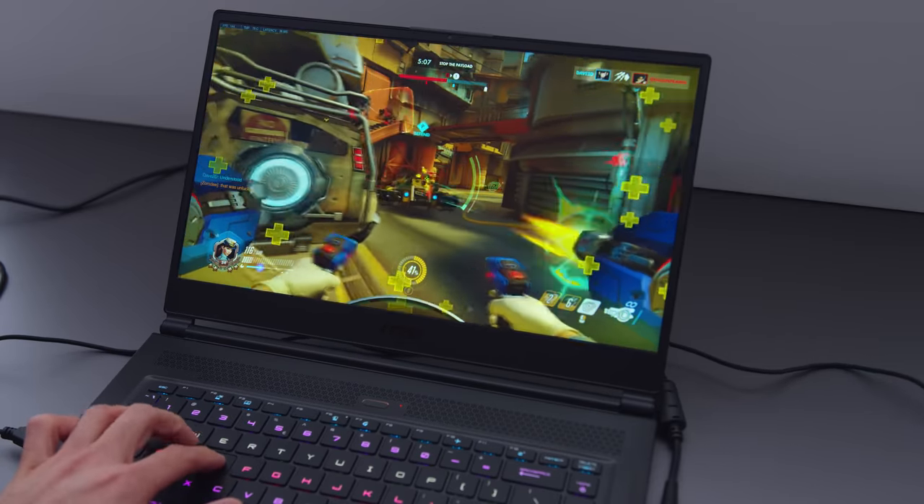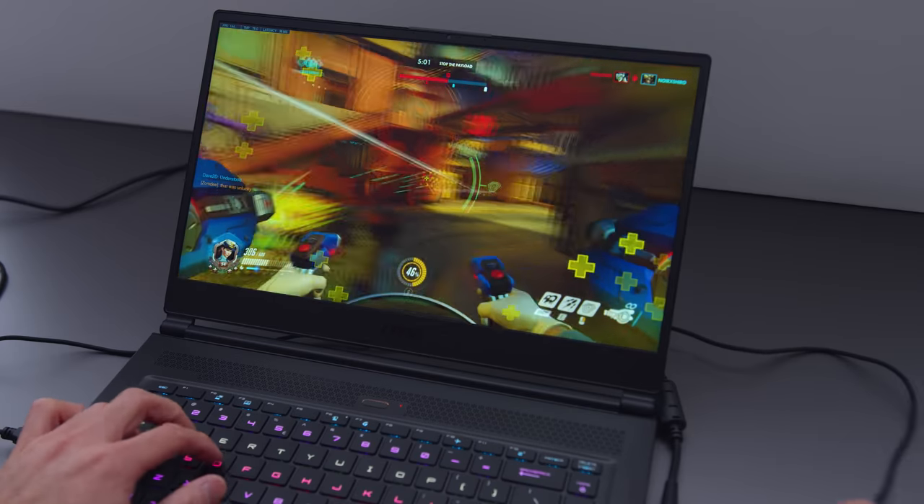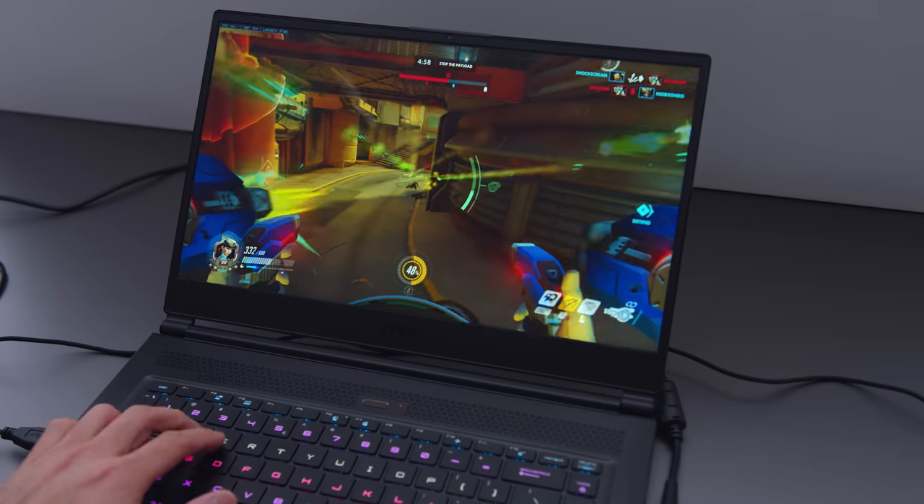One thing to note: this display does not have G-Sync, and I think for some people that's a deal breaker, but the truth is I actually like that it doesn't have it. Number one, it keeps the price down — if they had a G-Sync licensed display, this would be an extra 100 or 200 bucks. The other thing is battery life: by not having G-Sync, you get to use NVIDIA Optimus, so you can use the onboard graphics to keep battery consumption down when you're not gaming. But the main reason is that G-Sync is only really useful at around 60 frames per second or slower. The moment you bust 60, 70, 80 frames per second, it's just not as useful. At 144 hertz, this thing can shoot way beyond the frame rates where G-Sync is clutch.